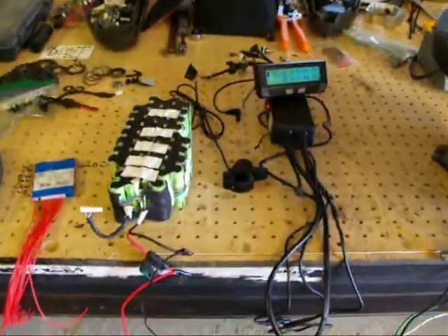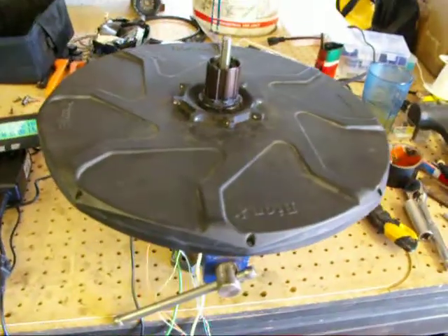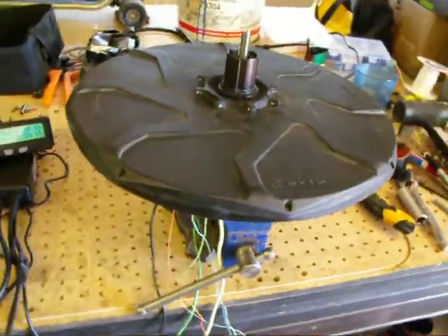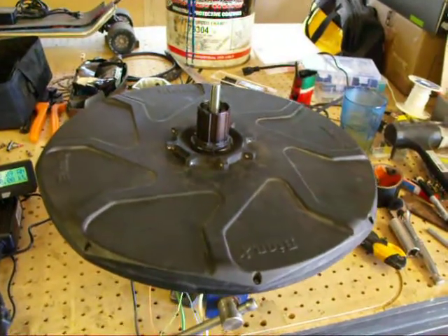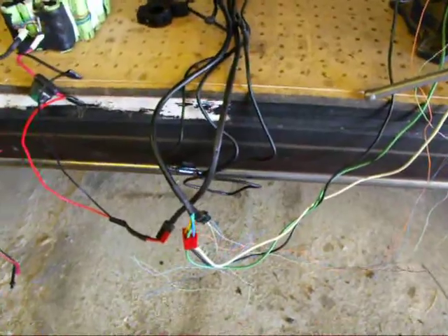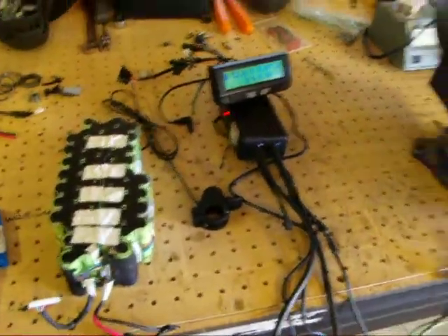Hello again, I've made some progress on my FionX motor so I figured I'd give you another update. I've had it apart two or three times tracing a bad wire. Now when I rotate it and check for voltage on my signal wires on the hall sensors, I'm getting a proper signal back — 4.4 volts on and off, just like it should, on all three sensors. I now have all three sensors and my phase wires wired out.